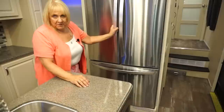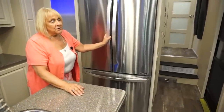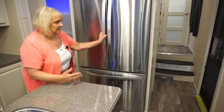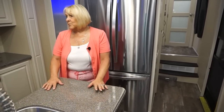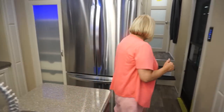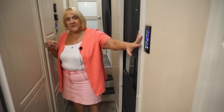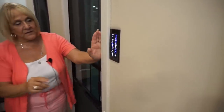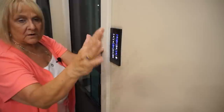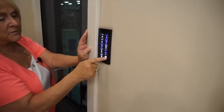Going upstairs, this one still has the multiplex system — there are panels all over the unit. Some run the ceiling fan, different lights, and almost all have master on and master off. The thermostat is one of the things that's really unique about our coach. This unit, being triple axle, is going to have three airs — but we are still a true dual-zoned unit. One air runs the front, two airs run the back downstairs. We actually have separate ductwork downstairs, a break in the ductwork, and then the rest upstairs. So if you want your bedroom cooler, you can turn this one down and it won't affect the downstairs.